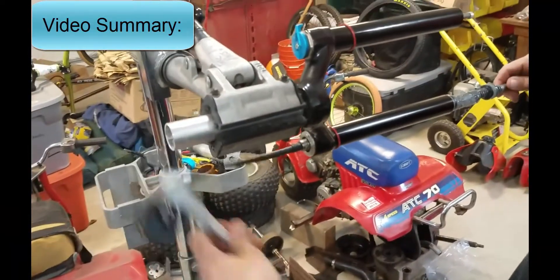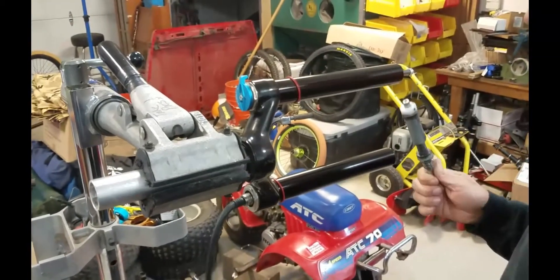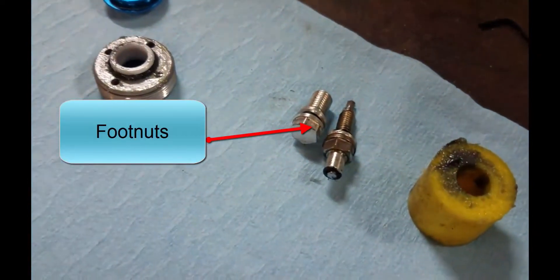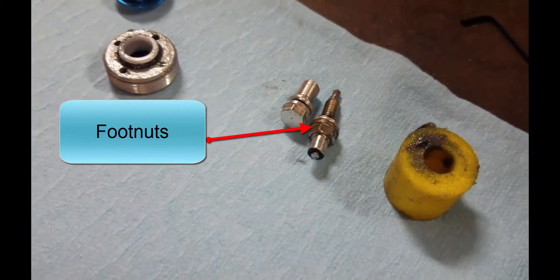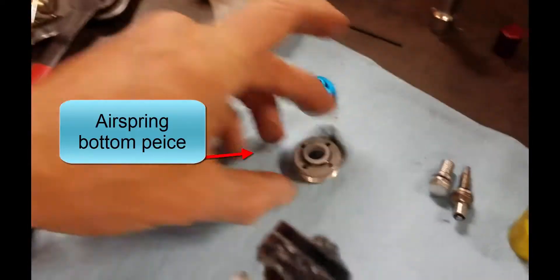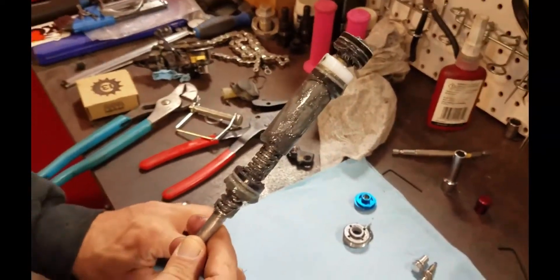Field dress this and you're pumping that thing out? Yeah. I'm just trying to get the piston out. That's the air side there. And then you used these and plugged them back in, tapped them out to loosen them from the lowers, pulled off the yellow cap, used snap ring pliers and the wrench to loosen that, and then just pump that air spring out.